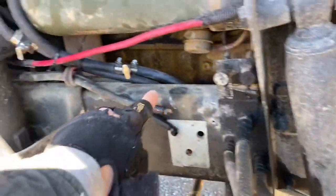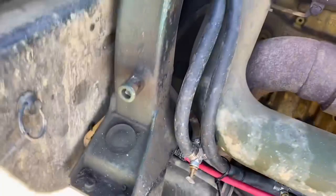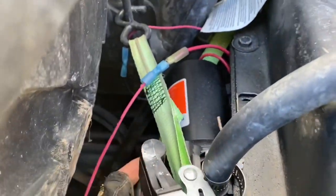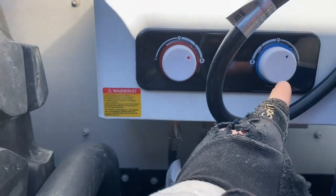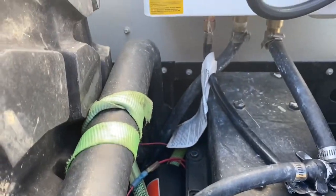So this is where the power goes — the switch is on the inside. I have the shutoff valves, and I'm going to open them up now. They're all five-eighths inch hoses and they run back to my pump — you can see it, it's got a little orange label. Right now it's all temporarily held in place with ratchet straps, but I'll secure it later. From the pump it goes into the inflow of the hot water heater. The settings I have it on right now are high heat and a little bit of water — less water, more heat. And then it comes out and goes right back into the green hose.